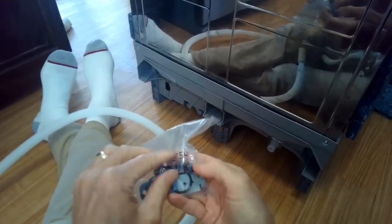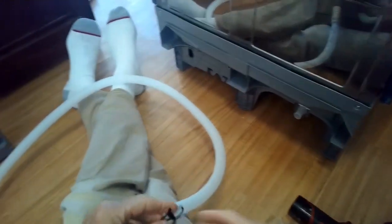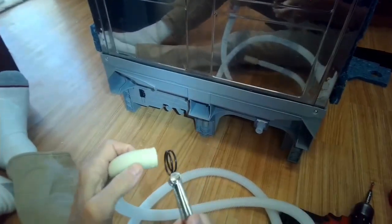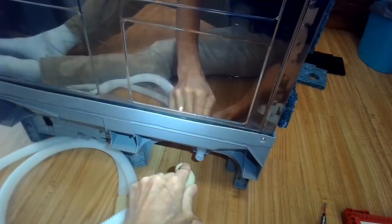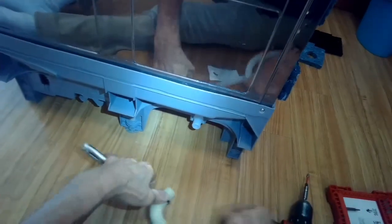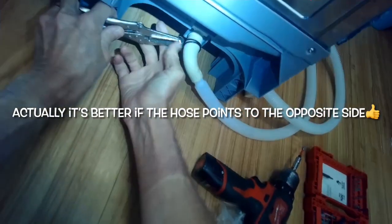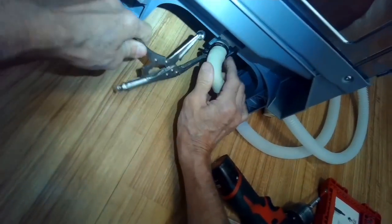It comes with a kit that includes a little hose clamp. I'm going to squish this with a pair of pliers — these are hose clamp pliers, but any kind of pliers or vice grips would work. Just get that over the rubber fitting, and then push it onto your dishwasher drain port as far as it'll go. Then get the hose clamp all the way on there, let go of the tension, and that'll be on nice and tight.